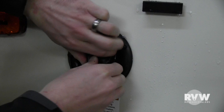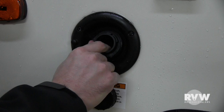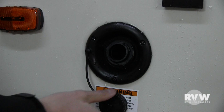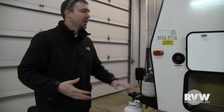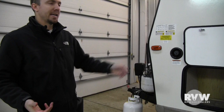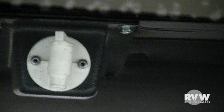Your fresh water fills right here. Take this cap off — if you're camping somewhere without water hookup, take your garden hose, stick it in here, and turn the water on to fill up the onboard tank. Then you'll use your 12-volt pump to pump out of this tank and pressurize your taps and water system. If your campground has water hookup, you won't need to worry about that. For the fresh water drain, there's a little valve right here — just turn that to open and drain your fresh water tank when not in use. Most people fill it up, go camping, then drain what's left before traveling so they're not hauling extra water weight.